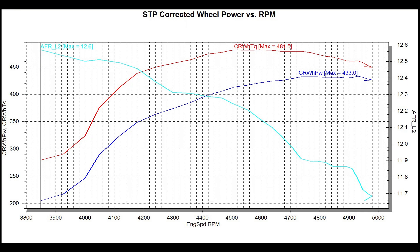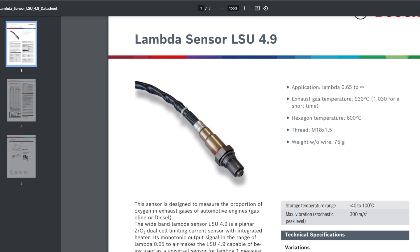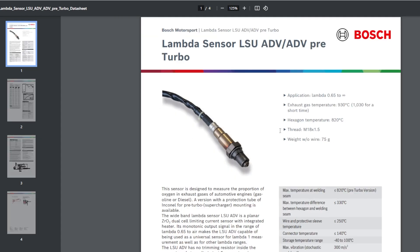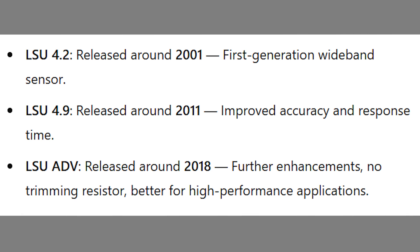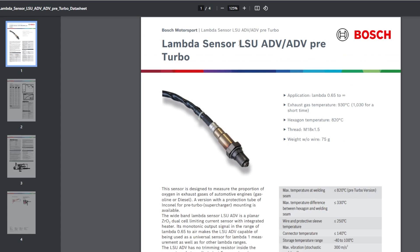Hopefully a 10-second run in the future. The tuners came back and said they don't think my wideband sensor is accurate enough, as theirs was showing different data. Bosch came out with a newer sensor around 2018 called the LSU Advance or ADV. The 4.9 came out around 2011 and was an upgrade to the older 2001 release the 4.2, so I decided to spend a little more money and get the LSU ADV.